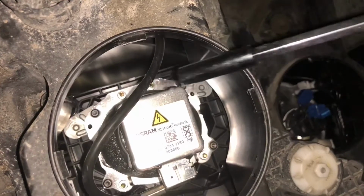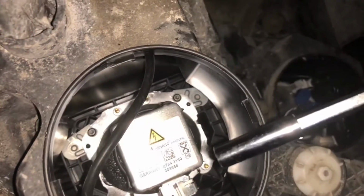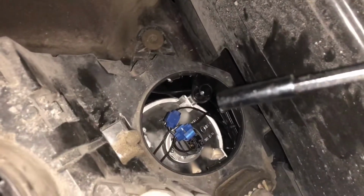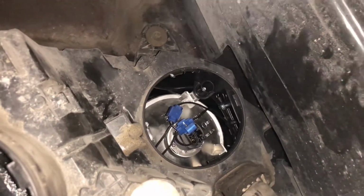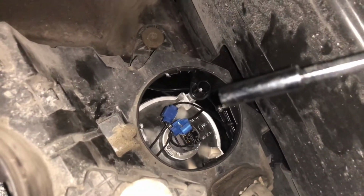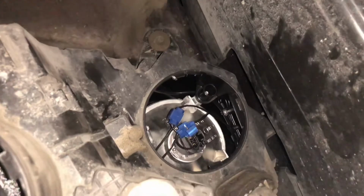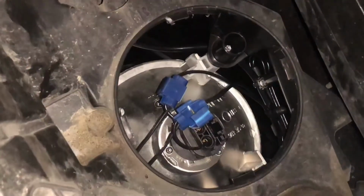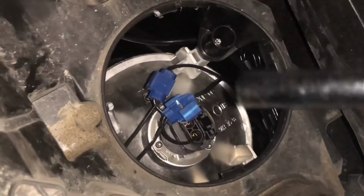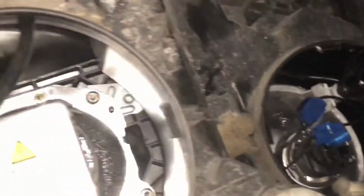It's really simple. So you take out the screws, put in the new projector, 4 screws back in, snug them up, and then I wanted to keep my high beam function with my halogens, as I would imagine most truck drivers do, because they're useful to have instant headlight or instant high beam in the daytime, whether to be courteous to other truck drivers or stupid ass cars that want to cut you off and whatnot. So it actually works out that the wire that comes with them is just enough that you can run them over to the high beam and just tap them in, so your high beam will function.